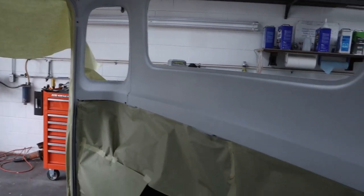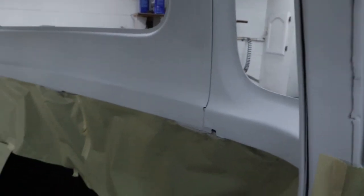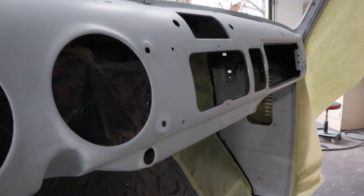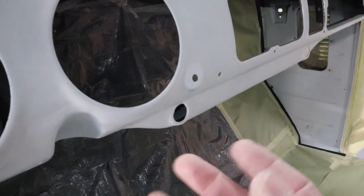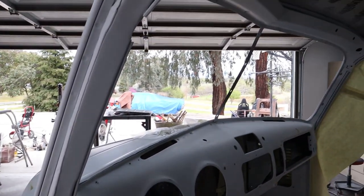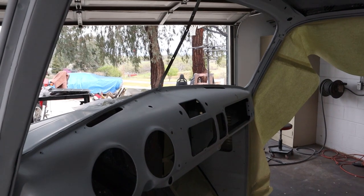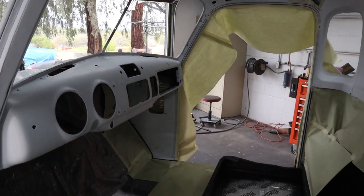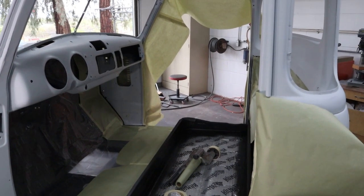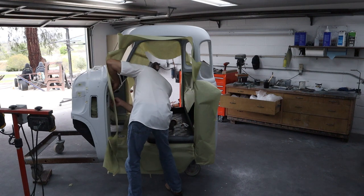The jam will be blue, so you can see the edge of it right here — this will be black and then blue from here on out. I've got some plastic down protecting the floorboard and the inner firewall, and I'm masking some of these lower holes on the dash itself so nothing blows out of the smaller ones. And of course I've got to do all the windows — three back here to get done. I don't want any overspray to get on the freshly sanded primer on the outside. So let me jump in here, go super speed, and get some of this masked up.